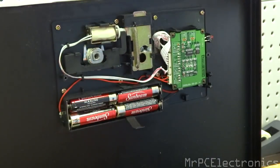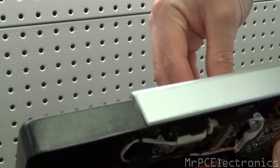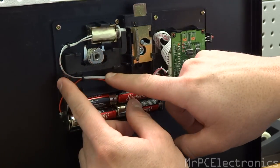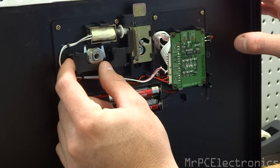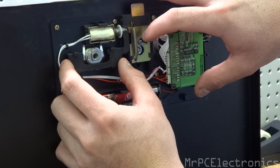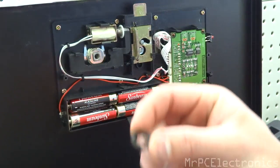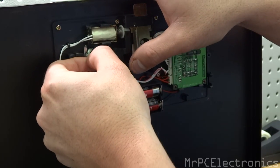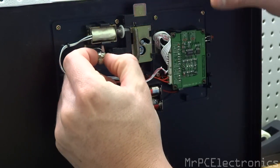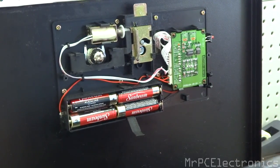Set that aside and now we're going to slide this over. In order to do this, we need to go back to the backside and turn it to the lock position. As you can see, it goes up, which gives us some space here. Now we need to take this slider and slide it all the way forward — not quite all the way, but just enough so it releases this little spring mechanism. Leave it right about there with the spring all the way out. Take the little gear, set it back on there, put the Phillips screw back in, and put the case back over.